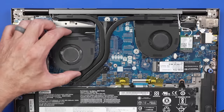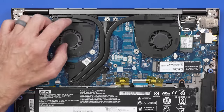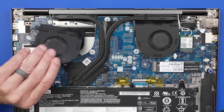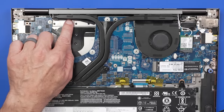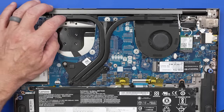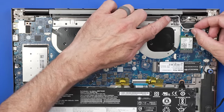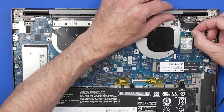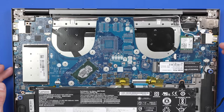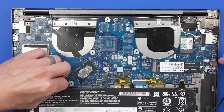This definitely would have been a problem. The fan was just kind of stuffed in here, and this little plastic piece was totally covering the heat sink fins. So if it would have been installed like that, it wouldn't have gotten any cooling through this heat sink and heat pipe. And this antenna wire right here was stuck up inside the hinge instead of being right down on the little tab where it should be. The repair shop that took this apart definitely did not put it back together the way it should have been.